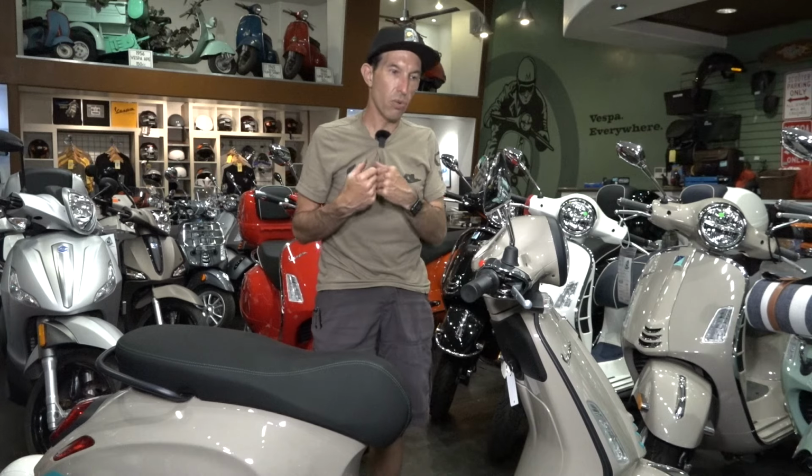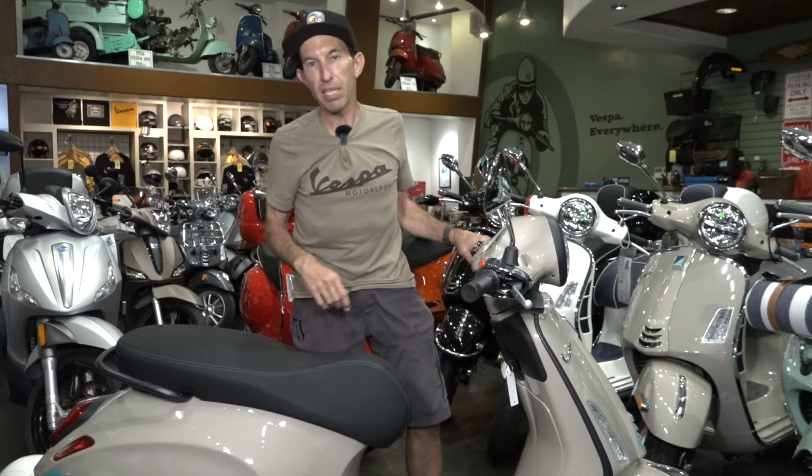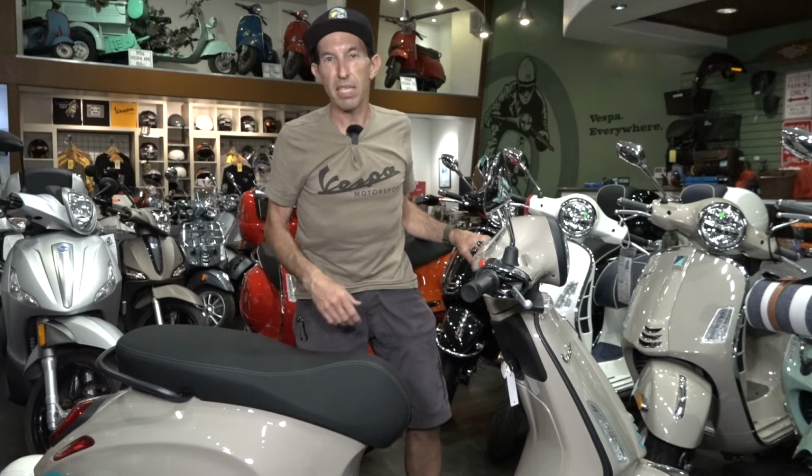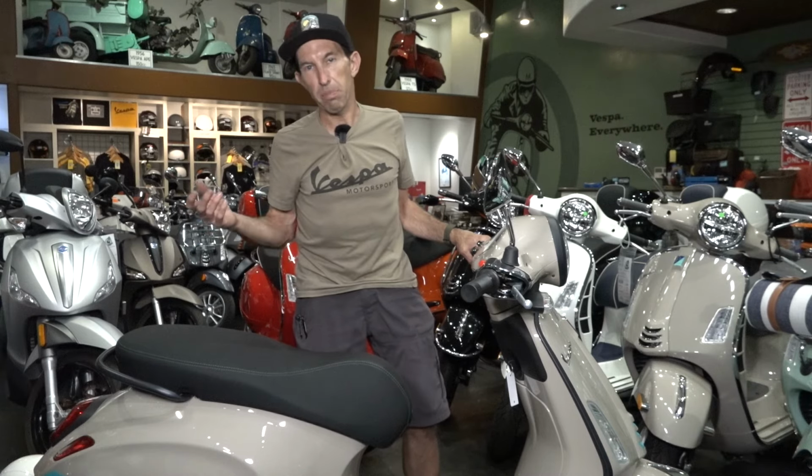It's very different than a car. The squeal noise on car brakes is typically when the brakes are worn to their service limit, because they have a piece of metal that intentionally makes a squeal noise. The squeal on scooter brakes is typically from brake dust buildup, and it may even come from the rear drum brake, which is typically pretty low maintenance. You could try blowing it out with some compressed air, but it's nothing to be concerned about.